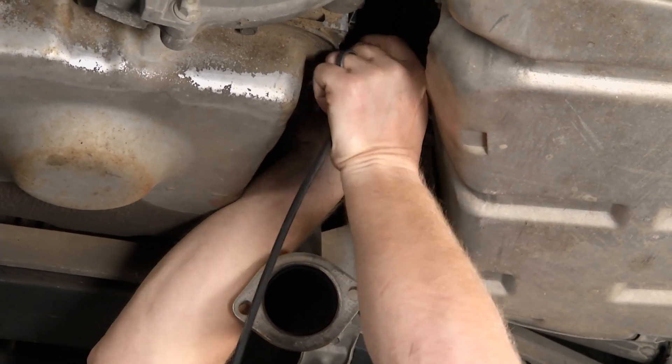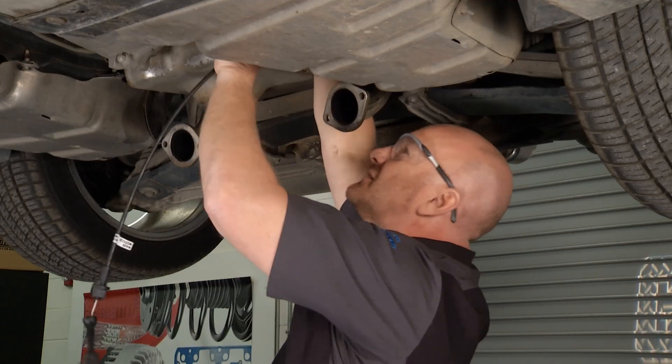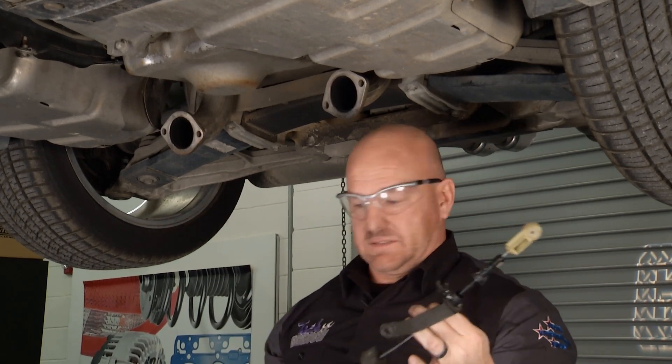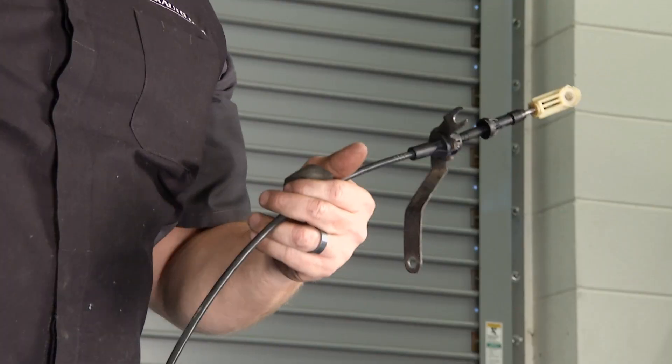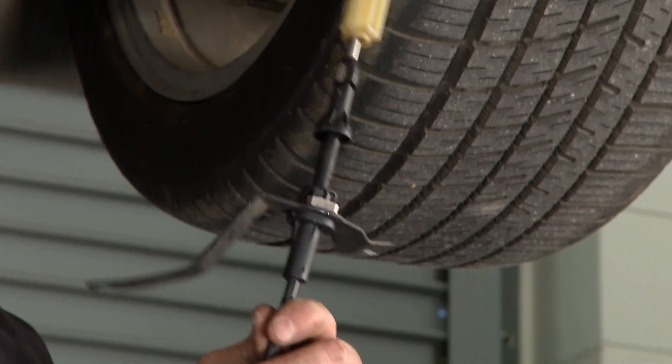On a C5 there are two common failures in this process: the shift indicator — the little orange arrow up top — which appears to be fine, and then there's a plastic linkage at the back that's a common failure. The shifter cable is not quite as common, but clearly this one's getting replaced. I'll work it down out of here and get back to the transmission itself. There's a bracket going up the side of the transmission with two 13-millimeter nuts — that top one will challenge you — but now the whole mounting bracket is loose and we can bring it down.